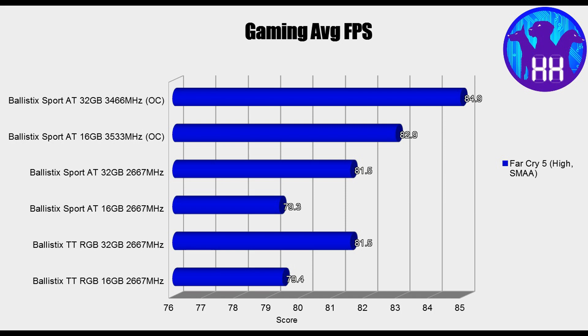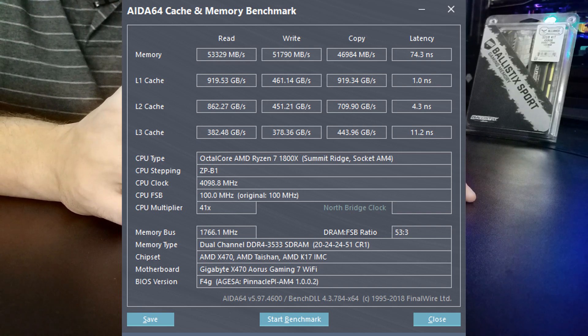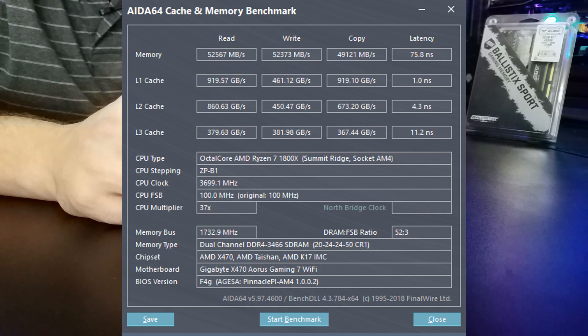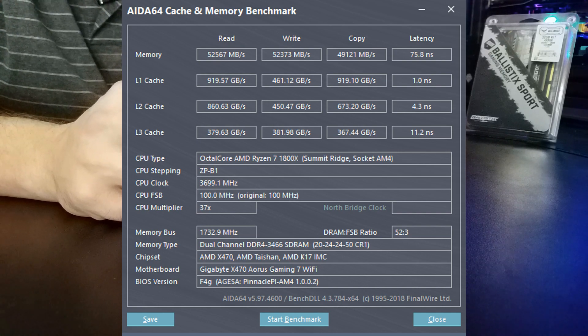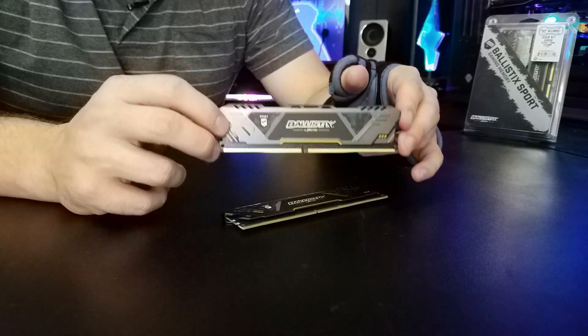The only complaint that I really have on a performance level is Ballistix did not include a temperature monitor in this kit. I tried HWiNFO — no temperature sensors. I was a little bummed about that because I really like the temperature sensors; if my temperatures are low enough, then I'll keep pushing voltages and push higher frequencies. Because I didn't have a temperature sensor, I maxed out at 1.4 volts and didn't go any higher. Getting a max overclock of over 3,500 MHz with that kind of voltage was phenomenal, and what was also impressive is even with the full four sticks, I still came just a notch below that at over 3,400 MHz. Excellent overclocking.